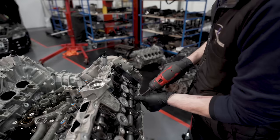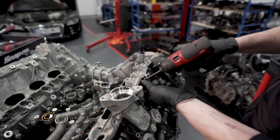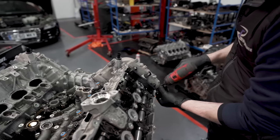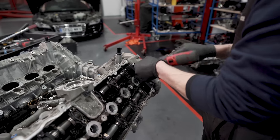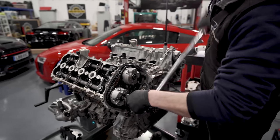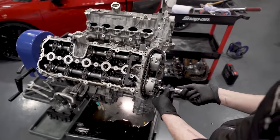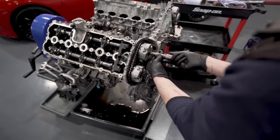We can take them off staggered. But remember as well that the cam bridge is glued on, so you've got to account for that. Take them off. So you can't muddle them up because they are inlet and exhaust. So the exhaust has it written on it, but if I pull one off, I'll show you.